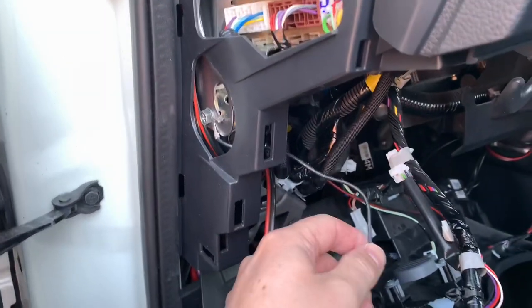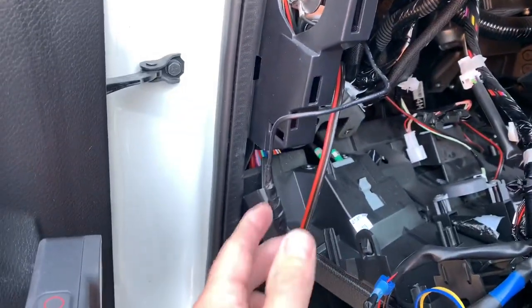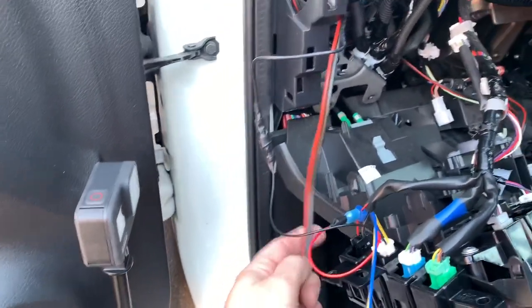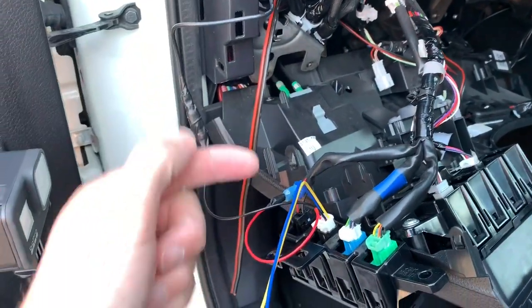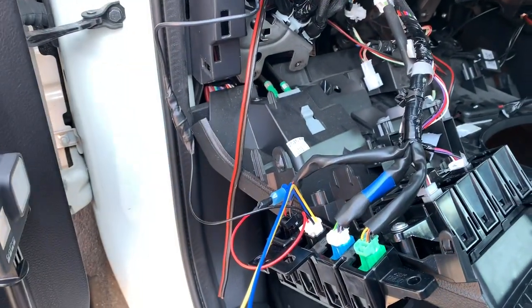Connecting the ground cabling now — this is quite a thick cable that will sit back here, and I can always use it if I want to connect other switches to it as well. I used a female and male connector but I used some isolation tape to keep them safe. So this is my toggle switch connected. Next step is connecting the accessory, but what I'm going to do is also install a fuse holder. So the signal is coming in from the engine bay through the fuse holder, into the toggle switch, and back to the engine bay to the accessory itself.